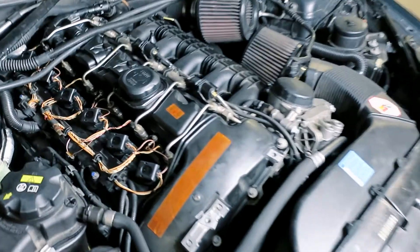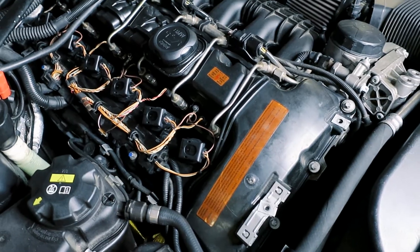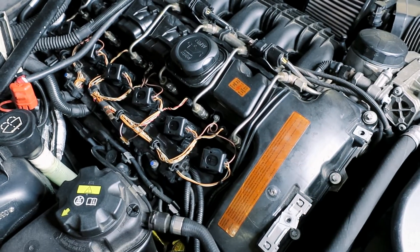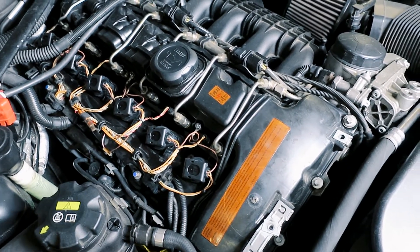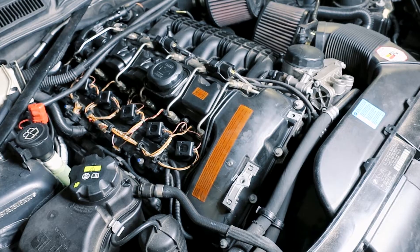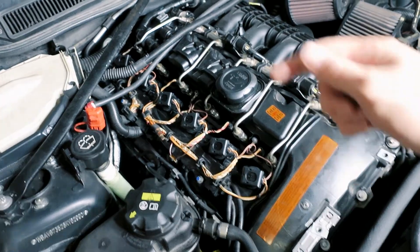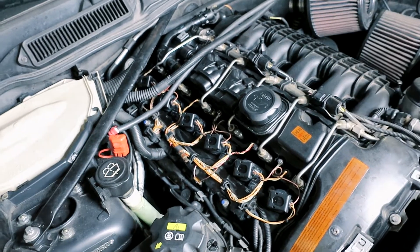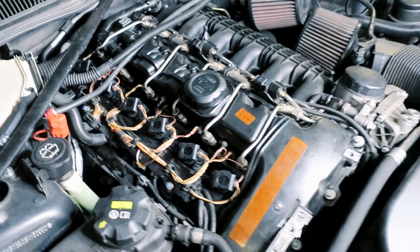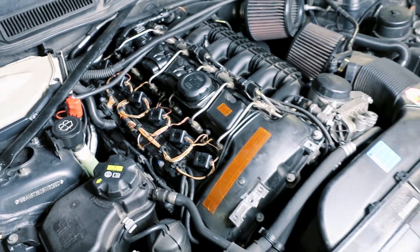To start with, I changed out the ignition coils because my car was misfiring and throwing a bunch of random codes — mostly mixture codes and misfire codes. I actually have a lifetime warranty on my coils, got those replaced for free, and I had a set of spare spark plugs that were known to be good. I changed them for maintenance, tossed those in, and no difference — the car ran the same. But what I noticed when I pulled the plugs out is the first three were fine, they were clean and looked normal. The last three — bank two — were really rich. So considering one bank was fine and one bank was rich, that kind of indicated a mismatch of reading, so I bought that O2 sensor without even connecting my laptop yet.